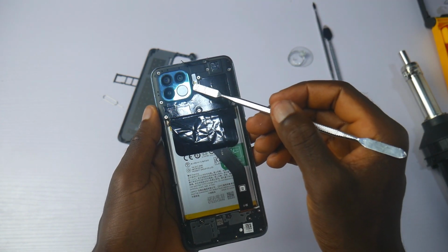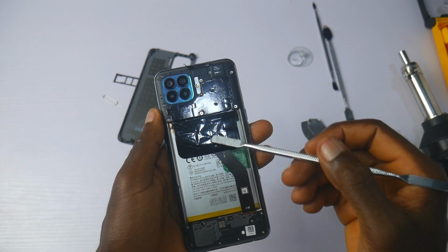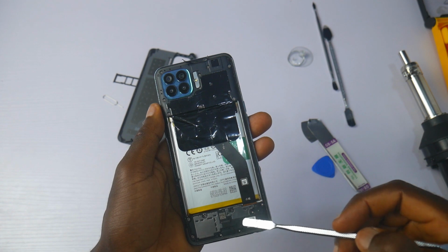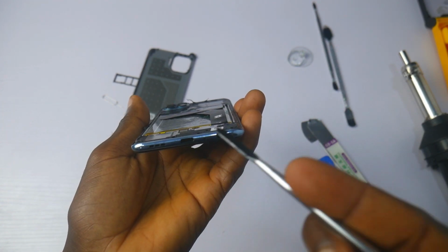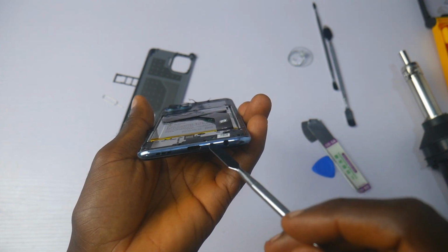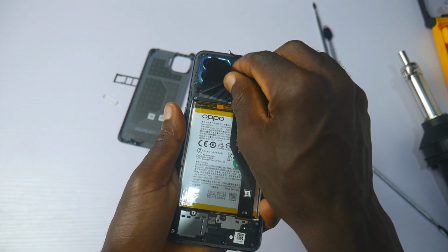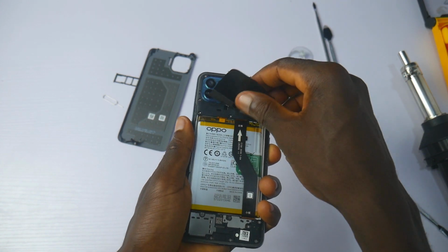The top, where we see the cameras and the main motherboard. The middle, where the 4000 mAh battery is occupying the whole spot. And then at the bottom, you get the bottom board that houses the main speaker, the USB Type-C, the mouthpiece, 3.5mm jack, and the vibration module. The flex, or this ribbon cable connecting the bottom board to the main board, is very visible at the top, and removing the black tape shows its direction of flow and its connection points.